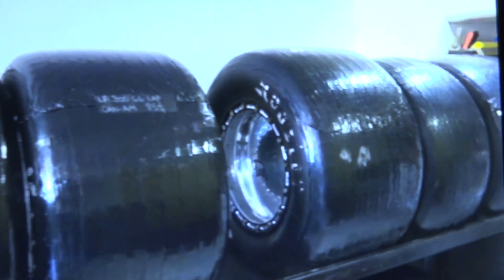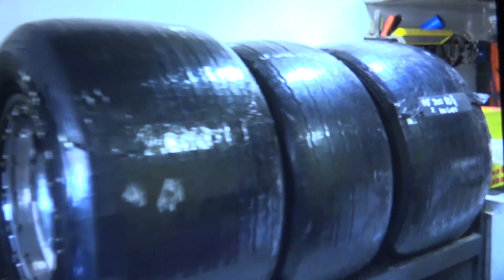There are different size tires, and I know the talls were out there. Have there been times when you haven't been able to get the stagger you want just because you don't have the numbers? Yes, several times. That's why I said we keep 10 or 12 tires mounted up, and sometimes you just can't get the tires with the tire shortage, but it's definitely gotten better lately. There are other adjustments you can do if you can't get the race stagger — little things you can do — so you live with it.